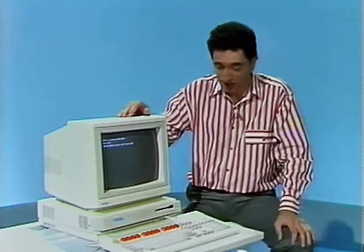You can choose various options like which display mode you want, which monitor type, keyboard repeat rate, capitals or lowercase, filing system in use, that kind of thing. All that's happened to produce that fault is I'd selected the wrong monitor type. There are basically two types of monitor, known as positive and negative pulse, and the system was simply expecting the other one. There are some standard settings for the configuration stored in ROM.